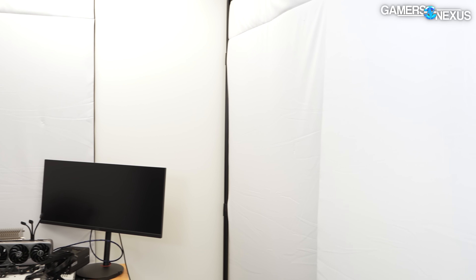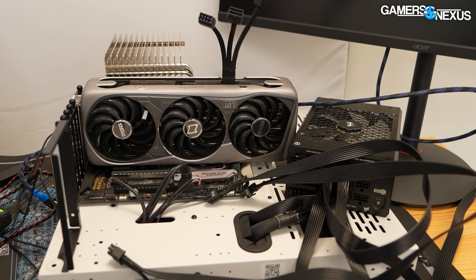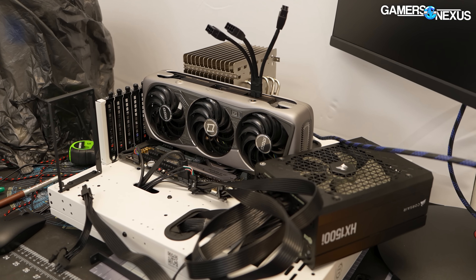The reason those fans aren't really doing anything thermally is because it's kind of like trying to help the ocean by pulling it toward the shore — these top fans are trying to help the much larger fans by pulling heat and air toward them, when there's a much stronger force that will overcome them anyway. In the noise booth, deactivating the fans showed a 0.8 dBA reduction versus having those fans on — up to 1.5 dBA reduction depending on where it is in the fan curve. So that was the main disadvantage of having the fans on.